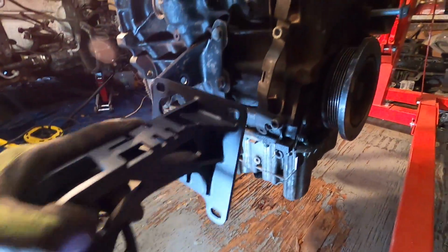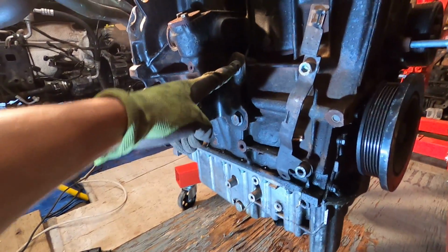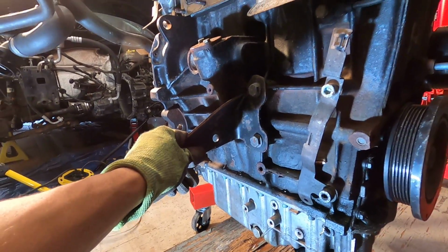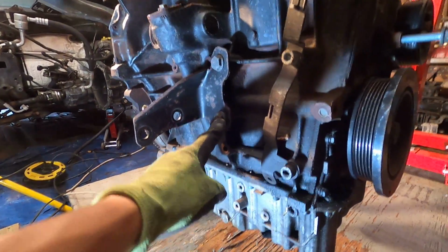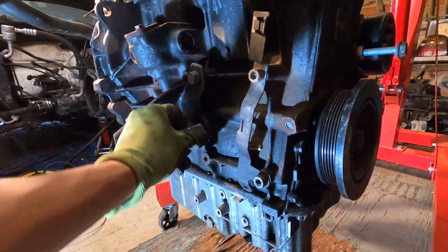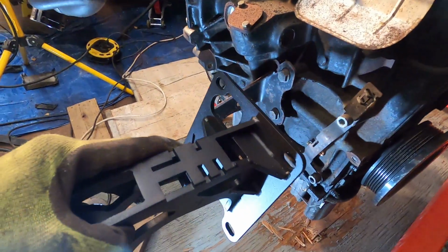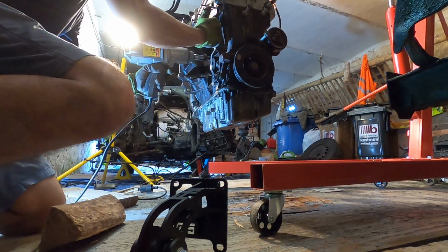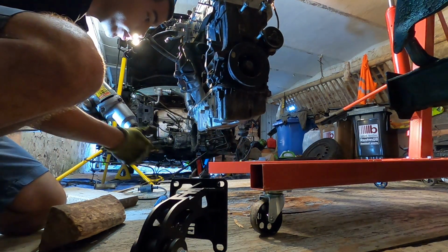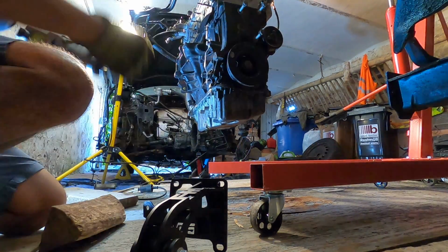So look at the back of the engine here. You can see with this new Mark III style mount, it's gonna go right here like so. So it looks like it's gonna be 1, 2, 3, and 4. So this is the bracket that they have on the 4Motion cars to brace the front diff, but that's coming off obviously. These are T50s, and I think these are 17s or 18s. Let me see. 17s. So we'll blast those off and get this thing mounted up. Oh, I think it's just so sick. 1 and 2. And I guess right now I'm going to use this hardware if it fits to there, which it should. And now we'll swap to our T50 bit here.